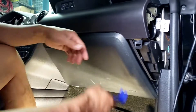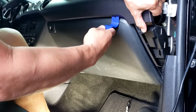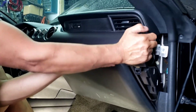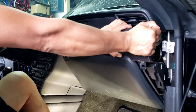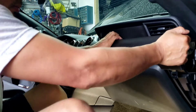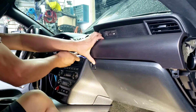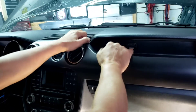Now I'm gonna try to go like this a little bit — try it out easy. You gotta be gentle. This is all clip, so you pull it out like this. Get a good full finger grip and pull it gently. Kind of tilt it around, not too much — if you pull too much you're gonna break half of these. Once you get it about less than half an inch, keep coming over with the tool. Just make sure you don't go more than two inches or you'll break something.